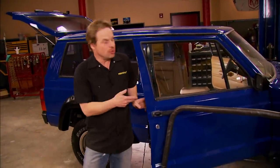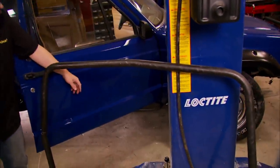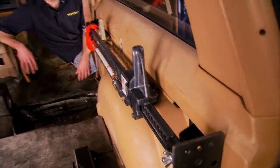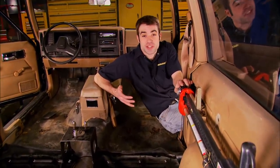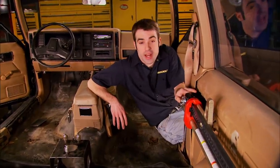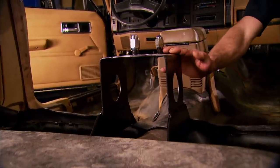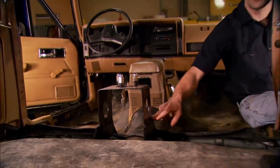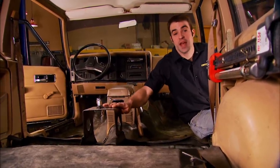If you've ever seen a rollover, unibody rig or not, it's brutal and some kind of protection is necessary. So we're not going to install a full cage, just a simple hoop. Since the last time you guys saw this Jeep, we've added a few must-have items, mostly to the interior, like this high lift jack. To make it accessible and keep it from knocking one of us out if it was just laying loose and bouncing around in the back, we went ahead and welded the mounting brackets to the interior body panels. Same with the mount for our 33 inch mud terrain, using a section of the old spare tire rack that was on the back of the Jeep.